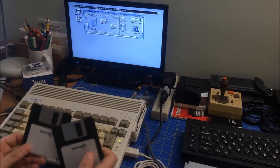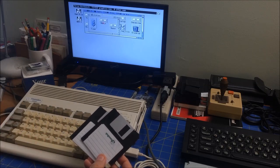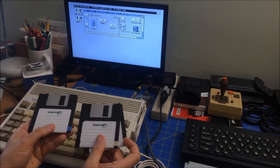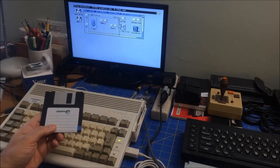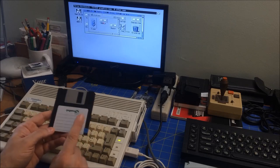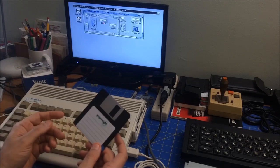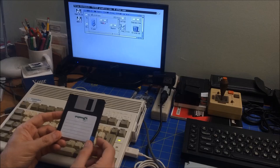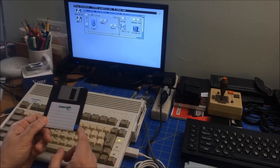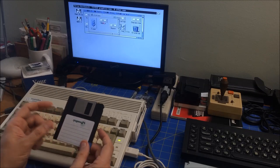So the one negative part about using MS-DOS, so these are actually empty Amiga formatted 880K floppies. This, on the other hand, got these marked with tan and blue. This, on the other hand, is a 720K floppy, and so the problem is this floppy is not as big. So generally, if I can zip up an ADF and have it be less than 720, it works. But one of the issues I run into is sometimes even a zipped up ADF file, because it already contains compressed information, is bigger than that. And so what I figured out how to do is I can split the file.